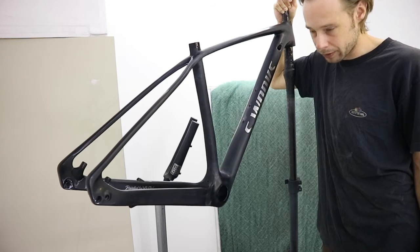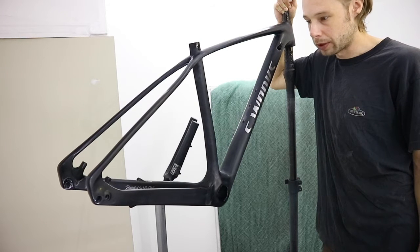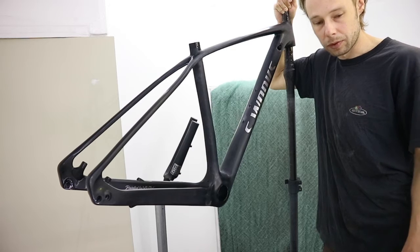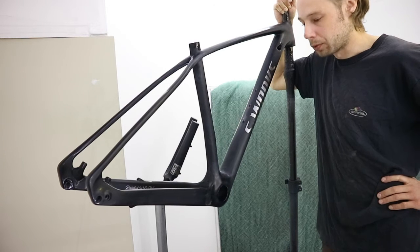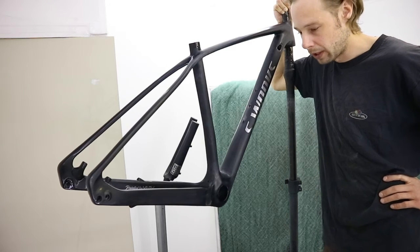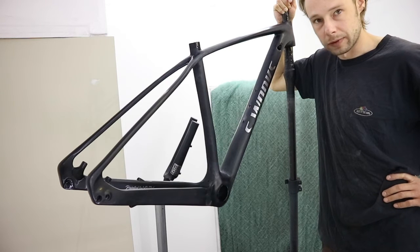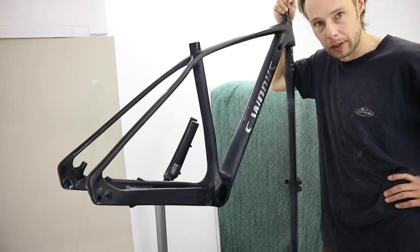It looks pretty much scratched at the moment, and that's actually good, because when you put a clear coat on a clear coat, if you don't do it right away, then you should scratch the surface a little bit, because it will give grip to the new layer of clear coat. And as I said, we used it as well to even out the surface that was pretty rough.